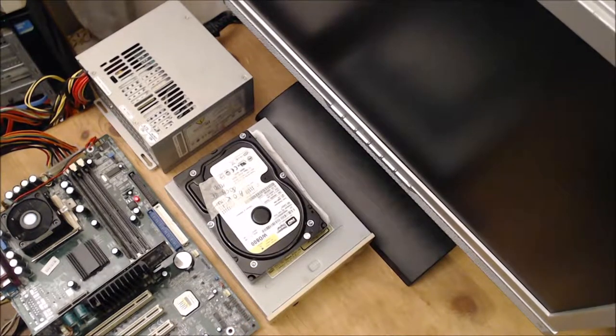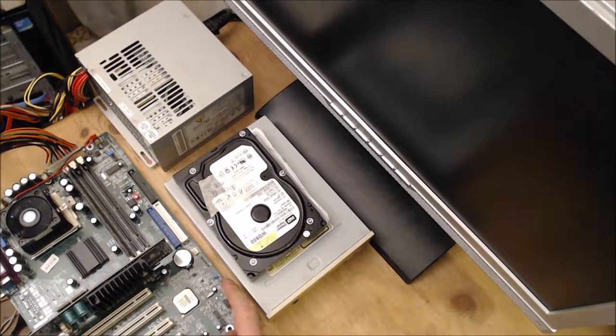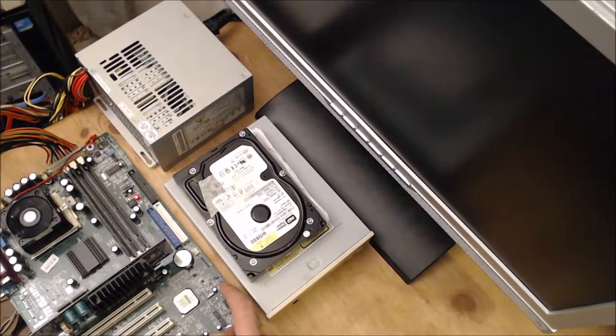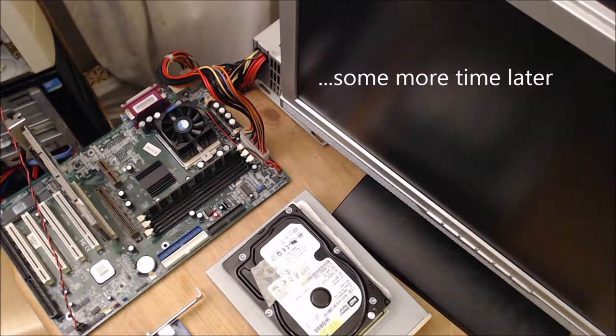Aha! There was a missing jumper here that was needed to tell the computer that everything was normal, except we are not getting anything on screen at the moment, which again means there could be something going on. What I'll do now is I'll get a PC speaker to connect. Almost will reach. Okay, we are back.